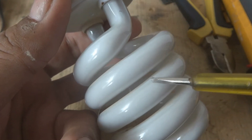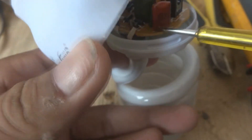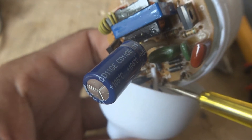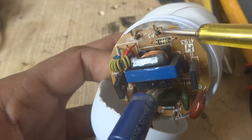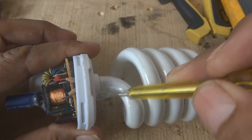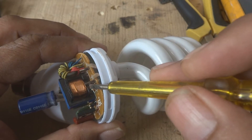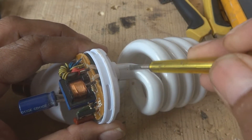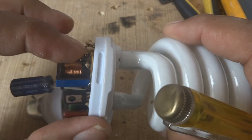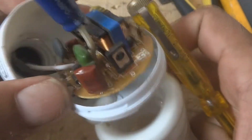Here is the glass element - you can see it has two pins here and two pins here inside, so there are four pins total. They are labeled P1, P2, P3, P4. There is one filament inside each glass leg. If you check the resistance it will be very low - five to ten ohms. If the resistance is open, it means the lamp filament is broken.